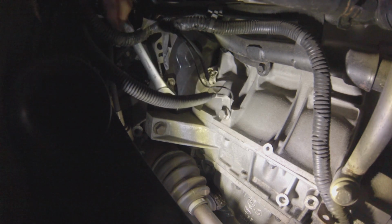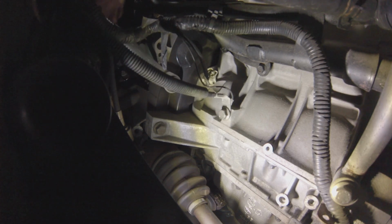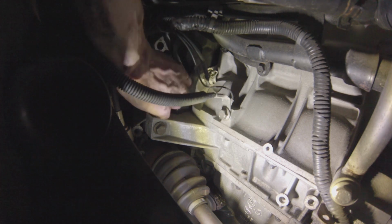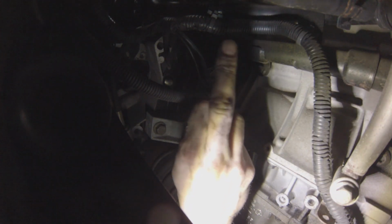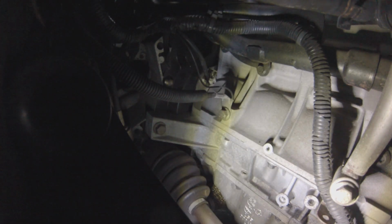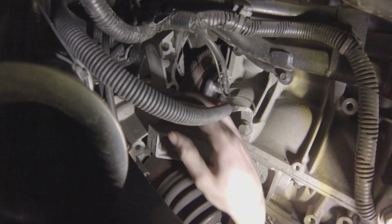Now, what you have to do after that is, you don't have to fully remove the starter motor. You just pull it back slightly. The aim of the game is just to leave free access to the flywheel crown gear, starter gear, and those are my thoughts about this setup right there. Took me ages to figure that one out. And so just remove that bloody plate and get rid of it for now. Don't forget to put it back on later on.